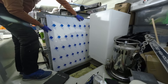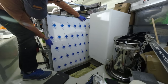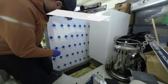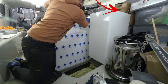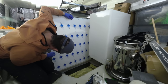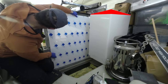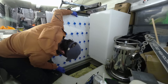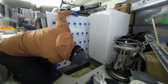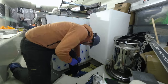Whilst you enjoy this view of me positioning the plastic and working out where the indents and bolts are going to end up, I'll expand on what's going to end up here. The worktop can hinge onto the top beam of the racking, and then rest with a rubber strip on the water tank itself. The tank actually sits angled slightly sternwards. This is because it buys me quite a lot of retained walkway space, and only loses me a little capacity in the tank. But it does mean that the tank's top won't be flat, but instead jauntily and indeed charmingly angled. To the side will soon be a sediment filter and a chemical filter, and finally a manual lever pump.